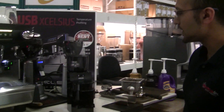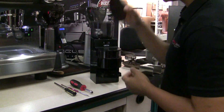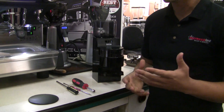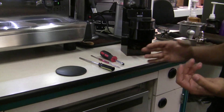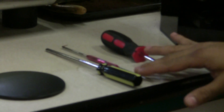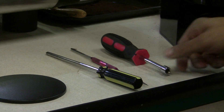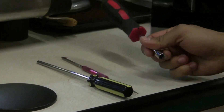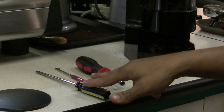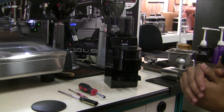We have the MDF right here. Start off by taking off the bean hopper lid. Before I start, a couple of tools that you'll be needing are just placed right here. You'll need a Phillips screwdriver, a medium or a small. A dental pick is nice — you need it to take out the guard, so you do need a pick of some sort; it'll make your life a lot easier. And I have here a 7mm nut driver. If you're just going to be cleaning your grinder, you basically just need the screwdriver and the pick, but to recalibrate it you will need the nut driver.